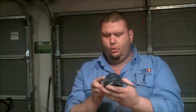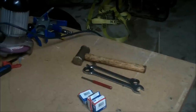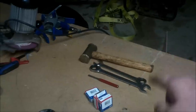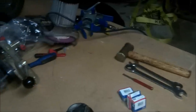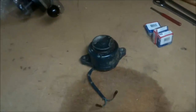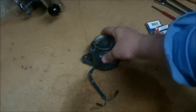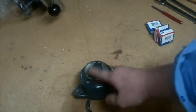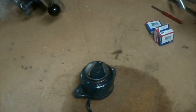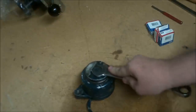When rebuilding one of these, really the only tools you'll need are a 19 millimeter, a 17 millimeter, a brass hammer, and a small punch. We'll start getting this thing disassembled right here. If you look right here on the front of the pulley, there are actually wrench flats where that 19 millimeter wrench will engage and you can turn this thing over.